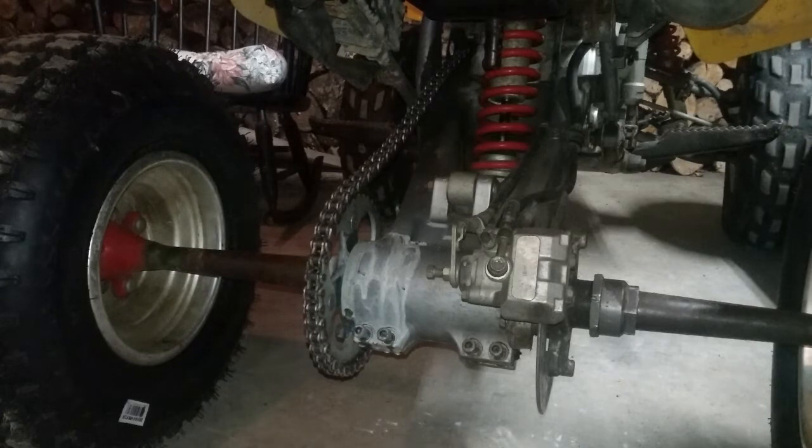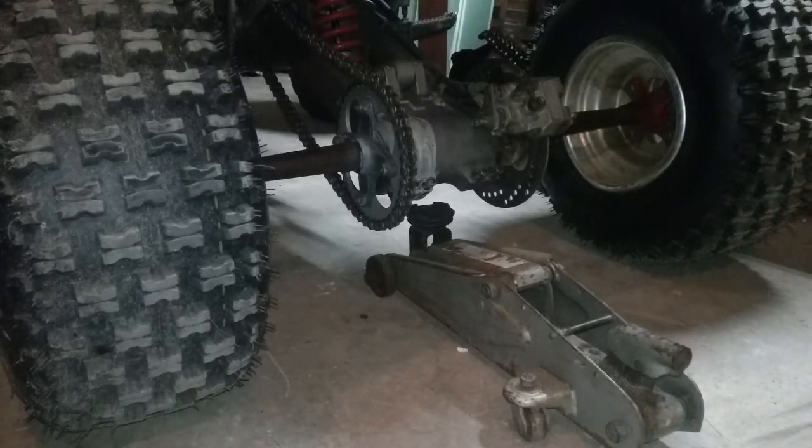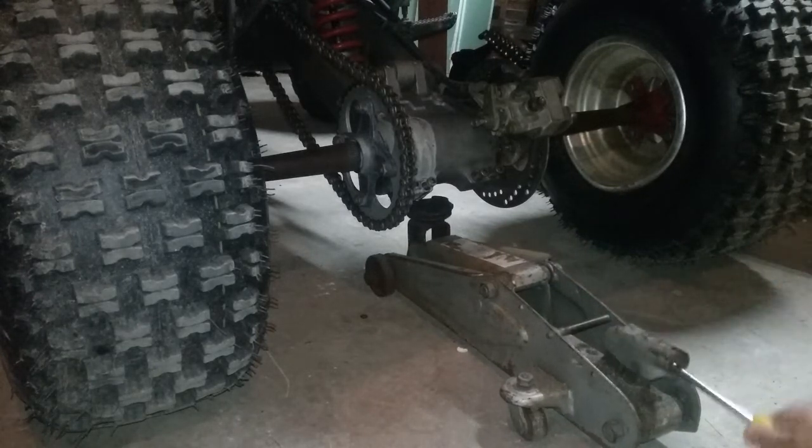Step two: I stick the jack up under the rear end. Right now I don't have a skid plate on, so if you have the original stock skid plate I'd say take that off first. Those stock skid plates don't last that long — especially on an 03, they used to be all metal, so one hard hit would fold them right up. The more you bend it back the weaker it gets. I recommend taking the skid plate off so the jack can actually grab the rear end really well.